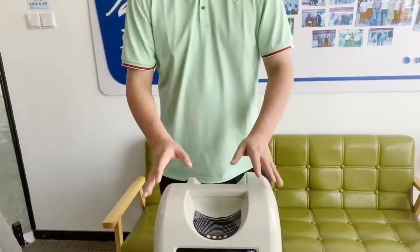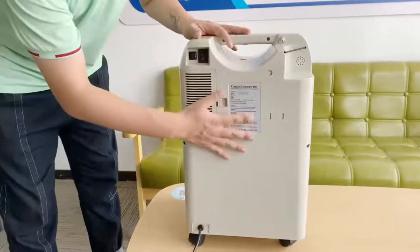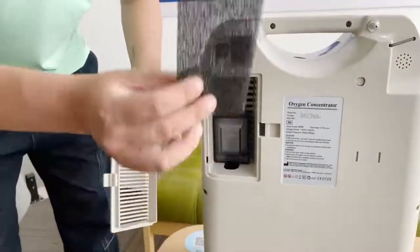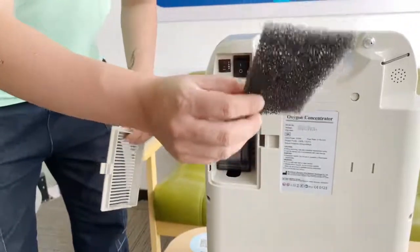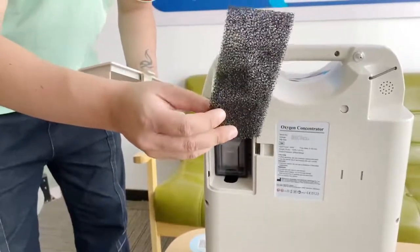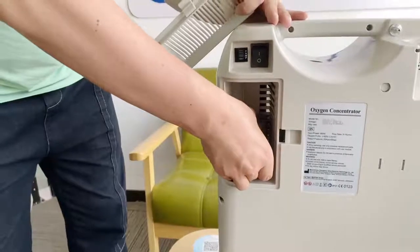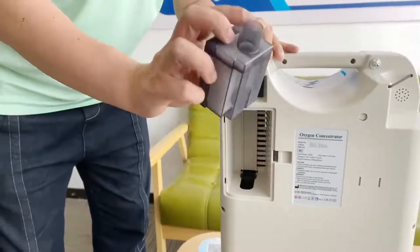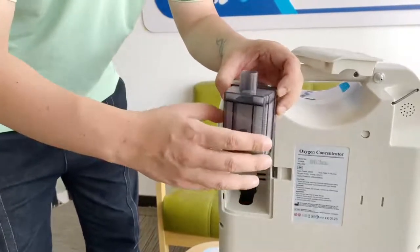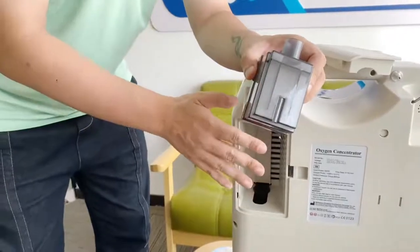Next, we'll cover how to do simple maintenance on our machine. First, remove the plug and turn off the machine. When you look at the back of the machine, there's a panel that can be opened. Inside you will see our filters. The first filter is the primary filter used to help filter air particles from the air — we suggest changing this every six months, but it is washable. There is also a second filter inside: our HEPA filter, our high-efficiency filter. This filter cannot be washed because it's inside a plastic component — we suggest changing this every three to six months, depending on how many hours you use the machine.